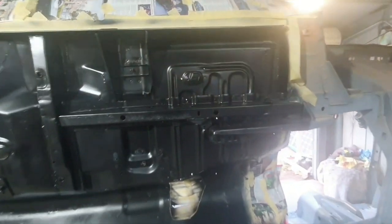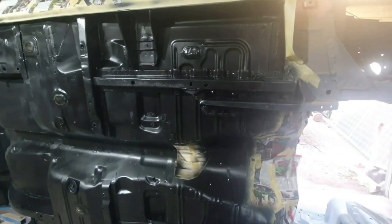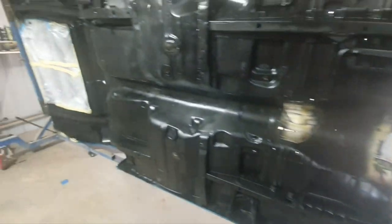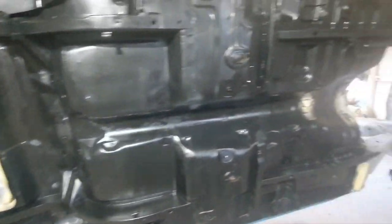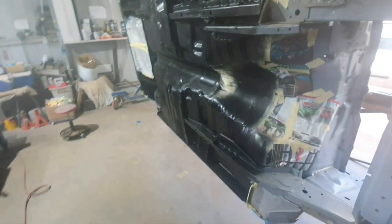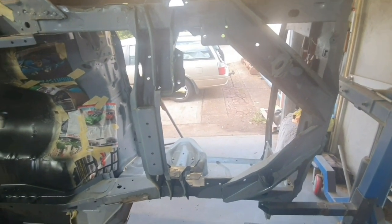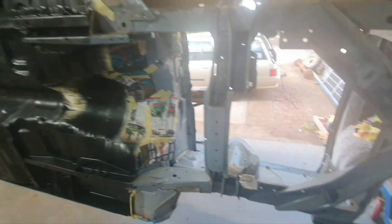I've given it the first coat, and this takes ages. Even with a two-and-a-half mil fluid tip it's still very slow, but you see what happens as it flashes off — it goes a bit matte black. I really put it on thick under here because that's probably where rocks come up. That's the first coat. I need to get up in this area, but I forgot to tape off so it's going to go in places I don't want it to go. I'll let this flash off a bit more — it's been about 45 minutes since I started. I'll get in there with tape, but I really need to paint all under these areas. I've almost run out of masking tape, I've only got this expensive tape. But I've got most of the work done — that's amazing underbody protection. Job completed.